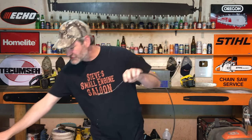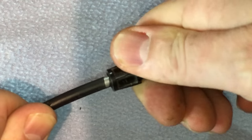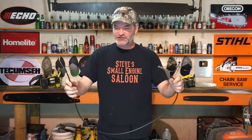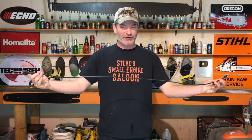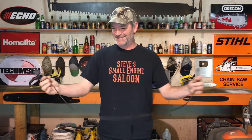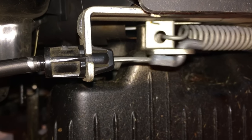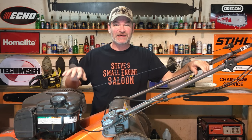You go back to the other side if that's not enough for you and you can also unscrew that side. What did that do? That just lengthened the total length of this outside plastic part of your cable by a half an inch. I know at home, guys, a half an inch is not that big of a deal, but for a cable, a half an inch longer is a huge deal. That is a huge difference right now — half an inch more pull — and sometimes that is going to fix it.